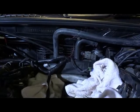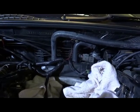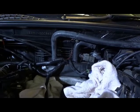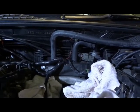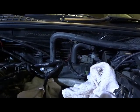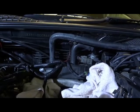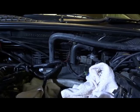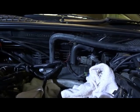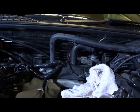Okay, I'll put the blanking plug into the manifold where the old sensor came out. Now we've got to move these hoses. They're sitting up too high. That top one is going to foul on the back of the supercharger, and the other one's in its road as well. So I'm going to lower the smaller one down probably about 20 mils or so and try and run the other big one in behind, so it'll be right back in against where the brake hoses and brake lines are that are going through there.